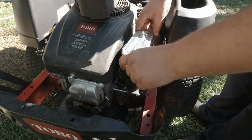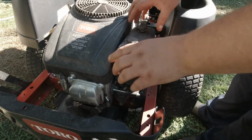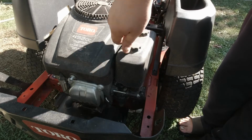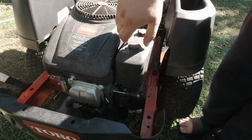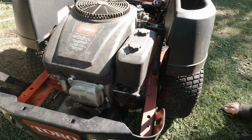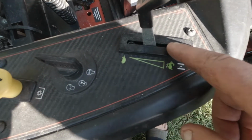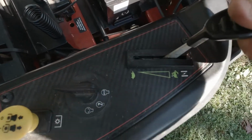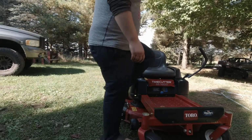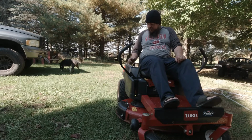It's a spray filter. Or do I have that on there? I don't know. Just didn't look right. Snug, snug, snug. I'm gonna change oil soon too, and then this thing was full of grass, so I was gonna give this a spray with the Fluid Film too on that cable in there. Okay, so let's see if she starts up better now that we cleaned that air filter and we lubricated the throttle. So we'll see what we got.